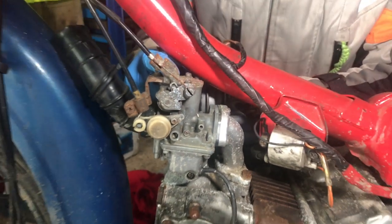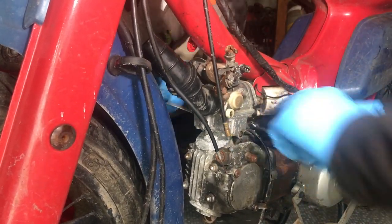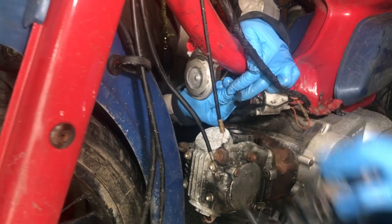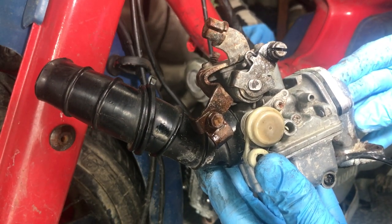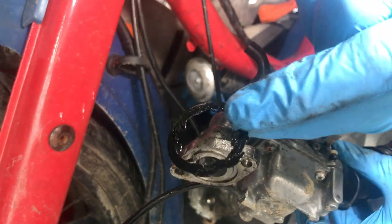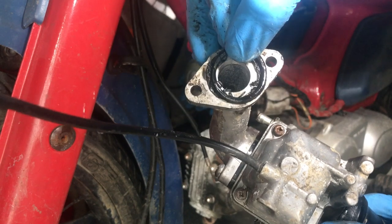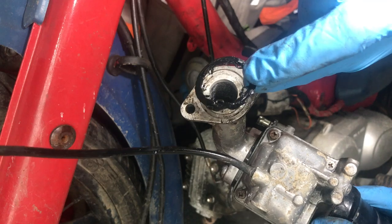We're going to now remove the carburettor and see what's going on with that. Right, the carburettor is off — let's have a look inside. Just had a quick look. The inlet ring piece is truly, truly, truly shot. So that should sit just there — that's where it joins onto the engine itself — and that is raged. Some pasty gubbins in there.